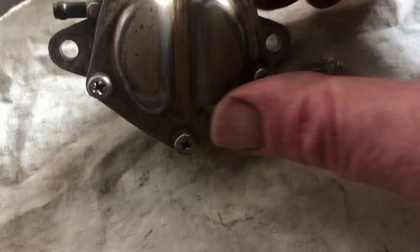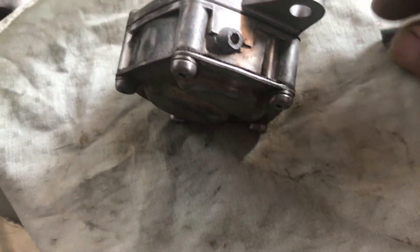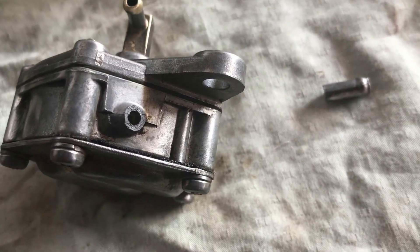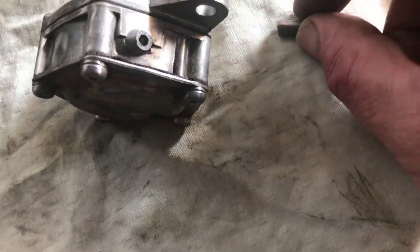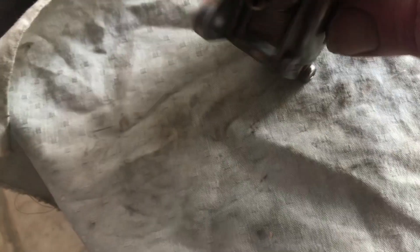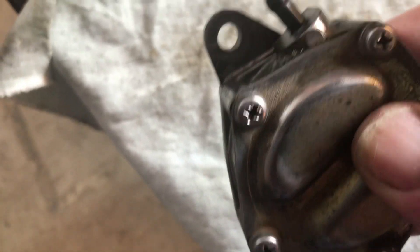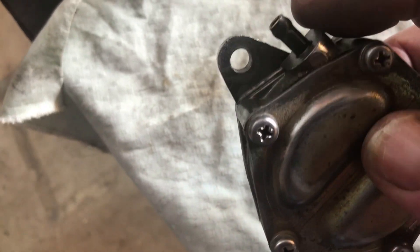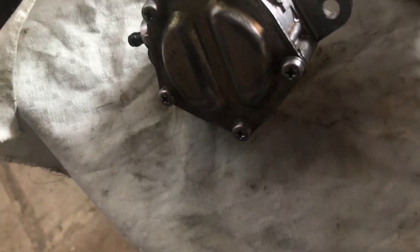What's wrong with this picture? That there just snapped off the side of the petrol pump when I was trying to jam a fuel hose on there. It's interesting - this side is cast with the base metal and the other side has a brass fitting in there, because there's a check valve at the end of that piece and a spring and things inside there. I think it must screw in. This side has just broken off.